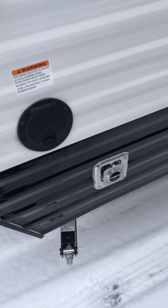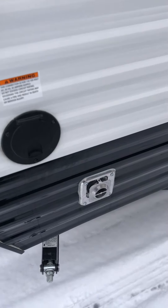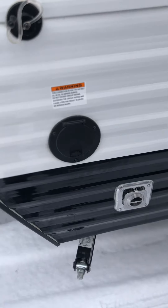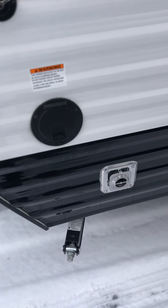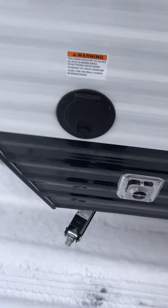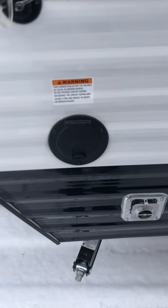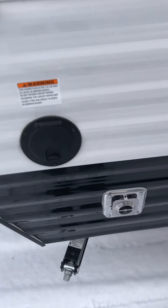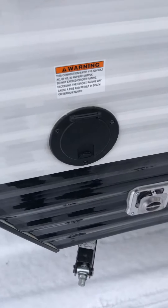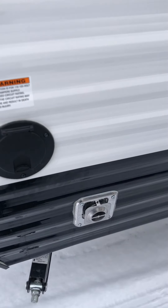Get your fridge cold a few days before your trip. The only thing you can't run at home is the air conditioner, because that requires the full 30-amp service. To run your AC at home you'd need a 30-amp outlet installed. A lot of people confuse this with a washer and dryer hookup — this is 120 volts, not 240, so do not plug it into the washer/dryer hookup.